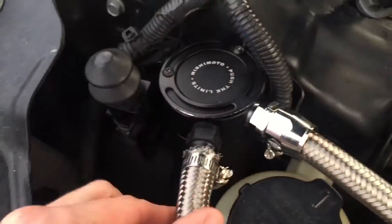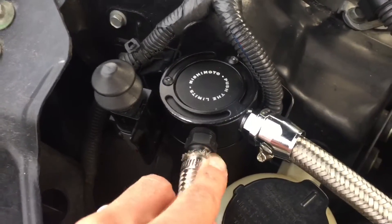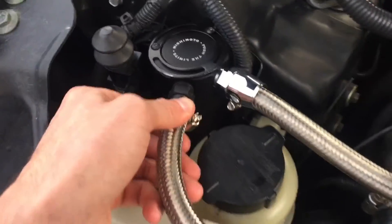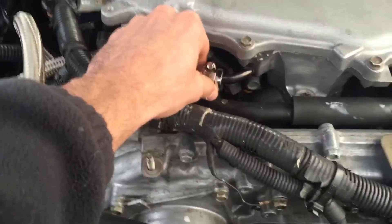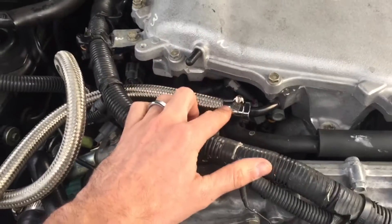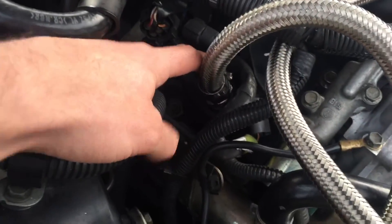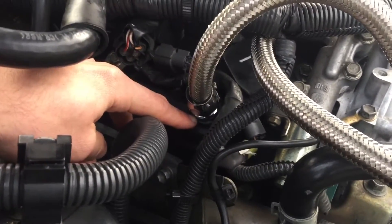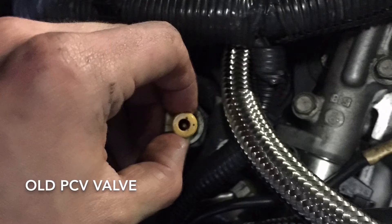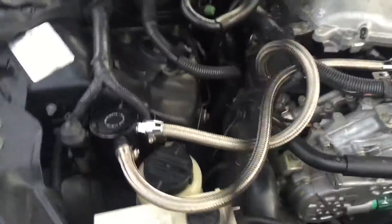You can see it's a bit braided and serrated at the end there — I have to go back and fix that up. Here's the actual fitting. The Spectra clamps I bought fit perfectly on the lower plenum and perfectly on the PCV valve down here. I also installed a brand new PCV valve — I'll show you a picture of that.